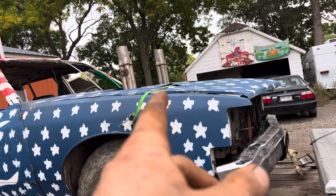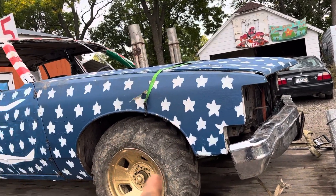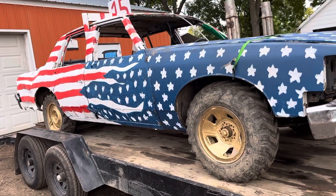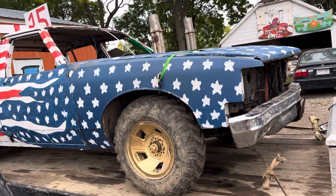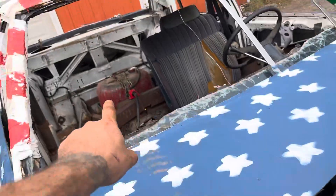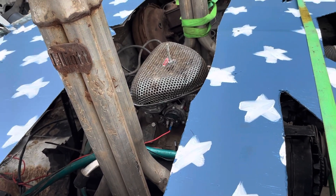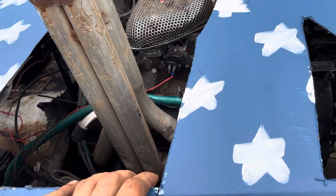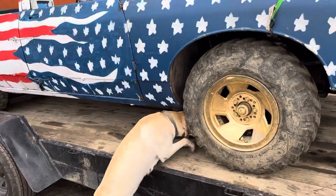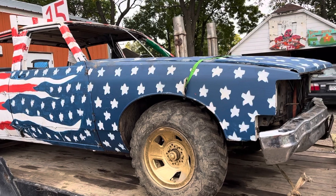I was having issues with this motor — the block pump went out. It was a brand new one too. I swapped it out, put it in, and it broke. That's why my truck wasn't running worth a crap. Since it broke, I decided to delete it — I put an Edelbrock inline fuel pump in. It's basically like a Holley carb style setup but it's not one. Everything's wired, zip-tied down, out of the way. I literally finished this thing last night around nine o'clock, after coming home from work and staying out in the shop till about 11:30, midnight every night. It's been a long week.